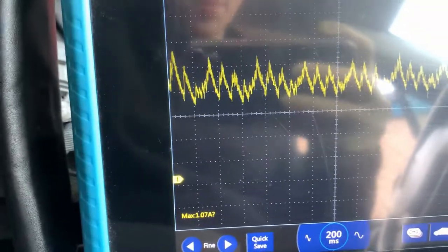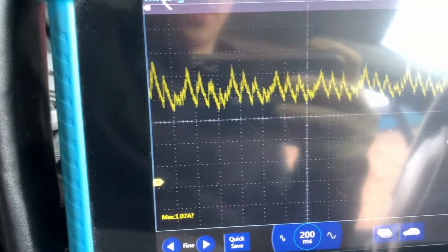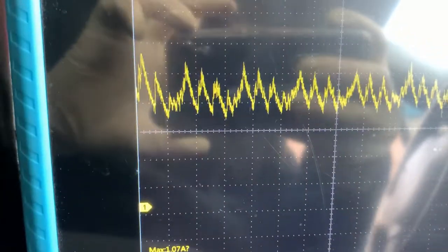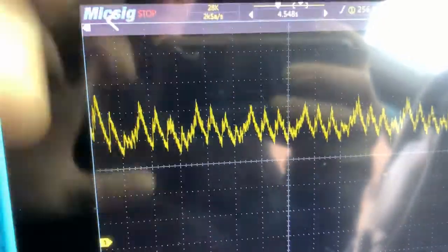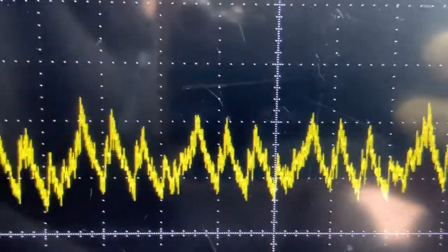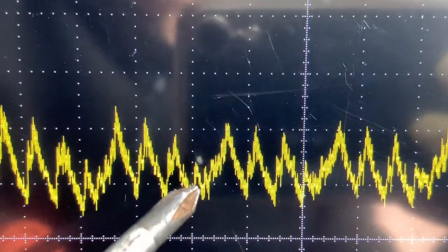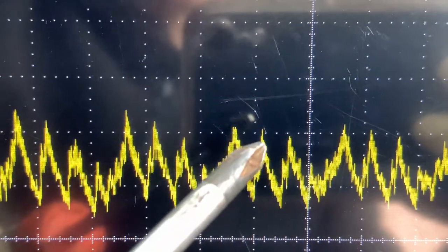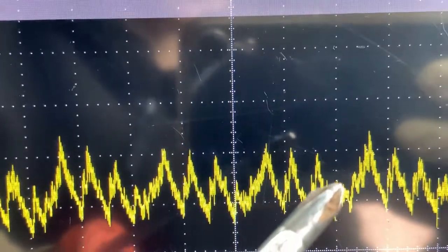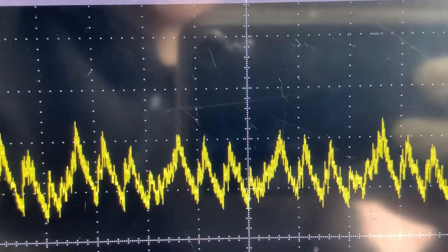I've managed to look at my files and I've found a bad relative compression — this was actually on an Audi S3. Cylinder 1 had low compression. This isn't the best capture I've done, as this was from the days when I wasn't really sure how to use this. But as you can see, if you look closely — we'll cut them out — we've got a nice even spike: one, two, three, missing; one, two, three, missing; one, two, three, and missing again. That little missing bump there represented cylinder one.